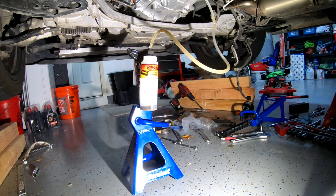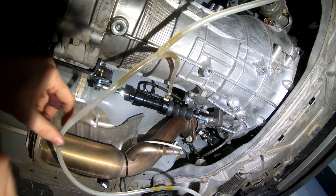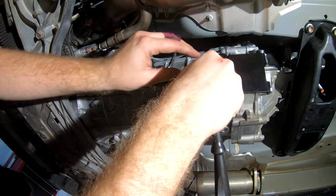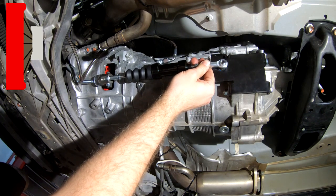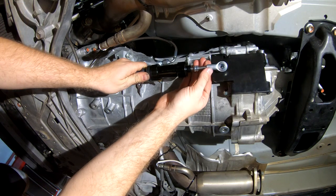At this point I stopped talking to the camera, but basically you're just going to keep bleeding the brake fluid until there's no more air left in the system and the old fluid drains out and starts to change color to that lighter amber color you'll see with newer brake fluid. While pumping your clutch you may want to have somebody visually check that the slave cylinder is actually actuating properly. With your clutch line bled properly, you're going to want to make one final adjustment to the slave cylinder by undoing the rear bolt that mounts it to the transmission, then pull on the slave cylinder towards the rear of the car to force the clutch fork and throwout bearing up against the pressure plate. Back off by about a millimeter so the throwout bearing is floating just about a millimeter above the pressure plate — not making contact all the time but close enough that you don't get a lot of clutch pedal play. Then readjust the length of your slave cylinder and re-bolt it to the car.